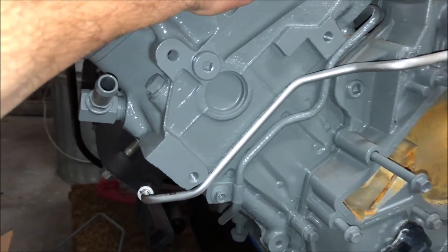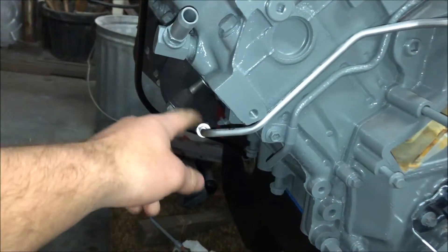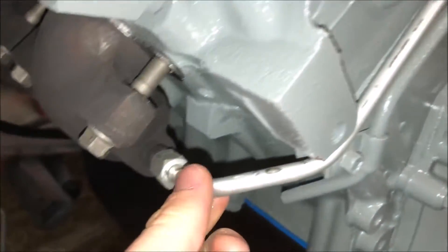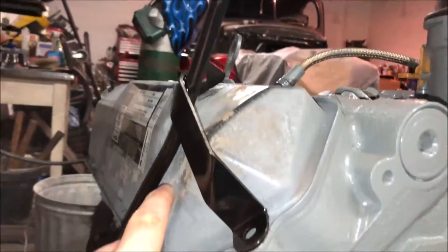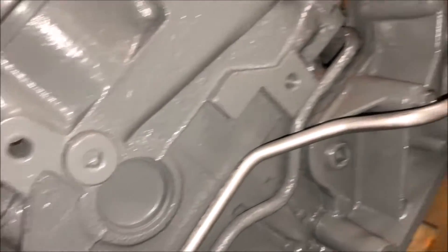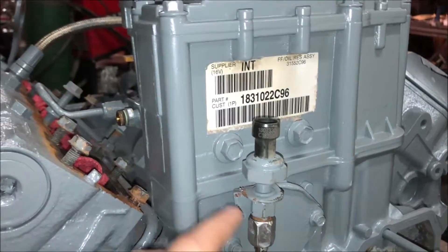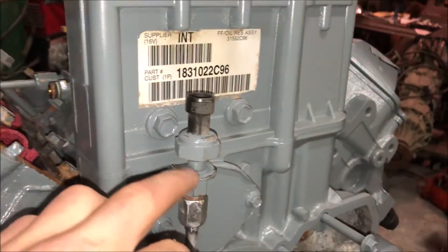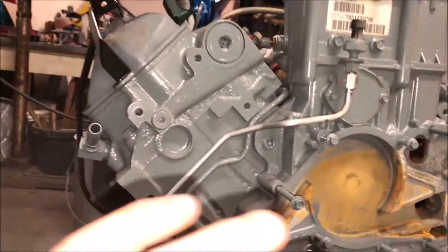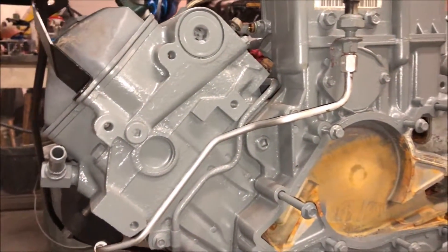If you're wondering why I'm putting that on — most likely yours is very rusty. And if you do try to remove the manifold, you're going to have to loosen this. What's going to happen is this is usually seized onto the tube, so when you try to loosen it, the entire tube spins and very easily cracks — just like your dipstick tube will probably do when you try to remove this bolt, just because they're rusty, very thin tubes. The only issue I had is when I removed this tube it was very tight, which slightly bent this, so I had to get it back into place so that it would correctly fit. It's a very snug fit around the block — it wraps right on it — so I had to get that back into place so those would successfully thread onto both sides. That was kind of a pain, but you gotta do what you gotta do.